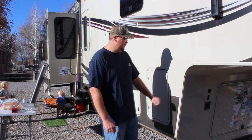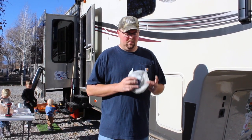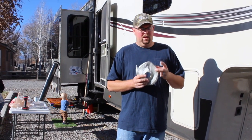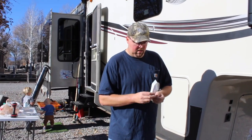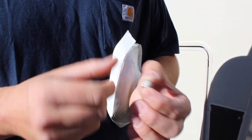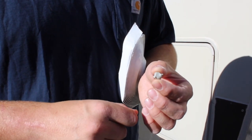So to make sure that our snaps are not leaking any water into the camper, we're going with this stuff. I don't remember what it's called. It's been a while since I've used it, but I'll look it up and link it in the description. What we're gonna do is take some of it and put it on the back of our snaps before we screw them into the camper. Just like that, and we'll screw them in and then peel off the excess, but it'll help keep water from getting inside the camper.